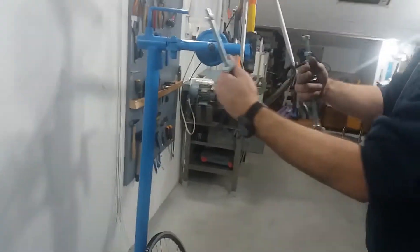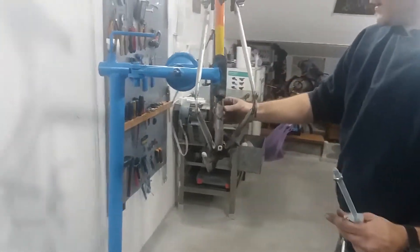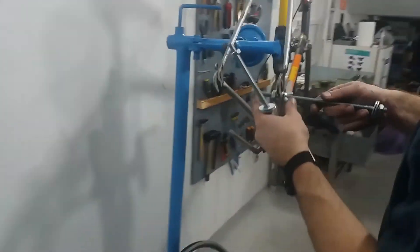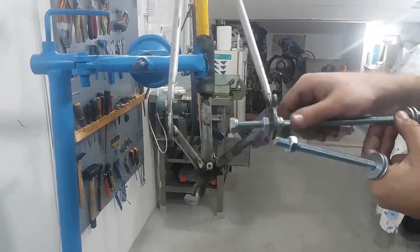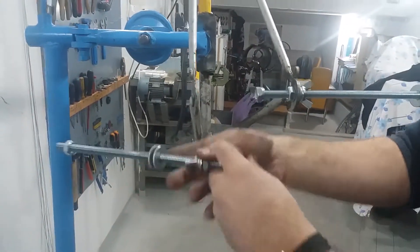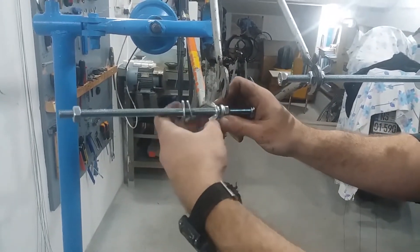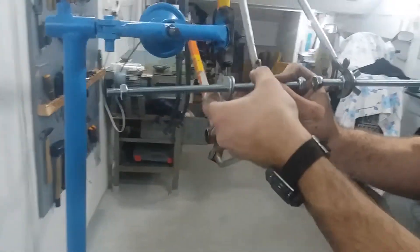In order to achieve this, there are two ways. The first one, which is in my opinion the preferable one because it allows for a stronger wheel — I will post links from my website on wheel design and strength — is this widening of dropouts, which makes the frame permanently wider to 130mm width, or at least 128mm width. Having two millimeters narrower is not a problem, just not too much over that.